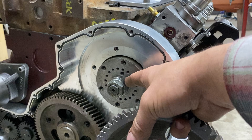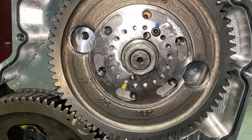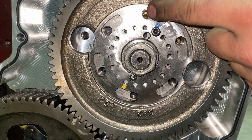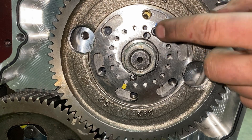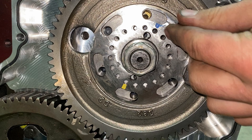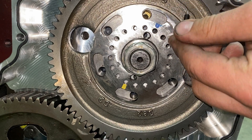If you're setting it up like this, you won't be able to get to 144 foot-pounds without the gear on and the engine altogether, so you can just snug it up for now. I'm going to put the gear on. I want these holes for the larger bolts on the far left side of the slot — that'll give you the greatest range of advance. You'll find the hole in which the smaller one fits, and that is your zero-degree timing.